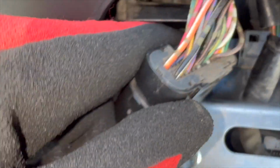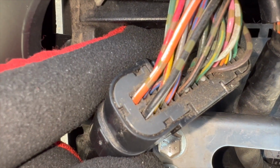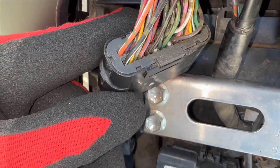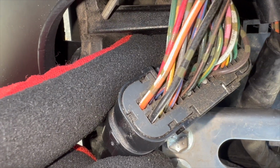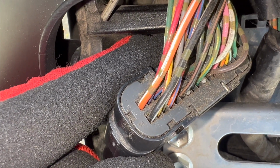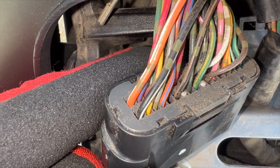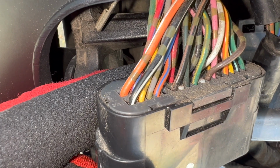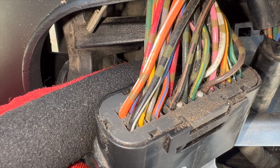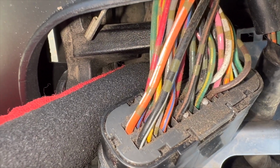Okay, cool. Y'all see that 34? It's like 34 right there. You can faintly see it. On that bottom row, where that black and white wire is, that's 34, the yellow one is 33. Whatever wire is next to that, like a green and gray, and then the next color one, that should be 31. And then pin 30 is the one that's missing.